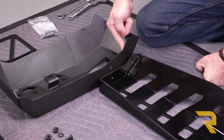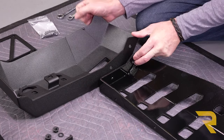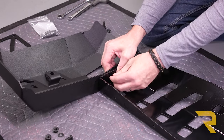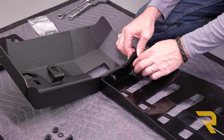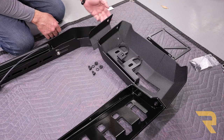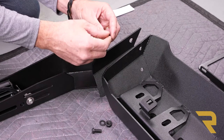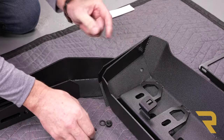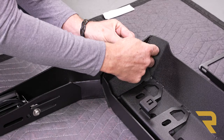You'll notice we've got a couple of holes in the side and a couple of holes in the base — those are going to line up and we've got some serrated flange bolts going through. Line those holes up and put them together finger tight. On the opposite side use a serrated flange nut, finger tight, and repeat the same on the opposite side. At the top end of each side we've also got holes that line up with holes on the top bar. Use an Allen head bolt with a washer through the top, line it up to the other hole, and use a serrated flange nut — then repeat on the other side.